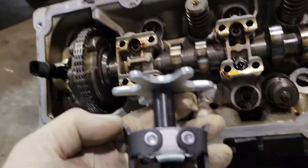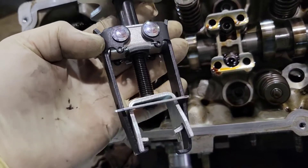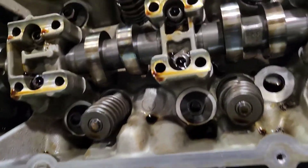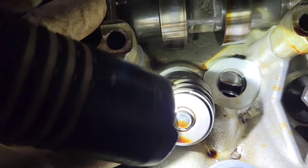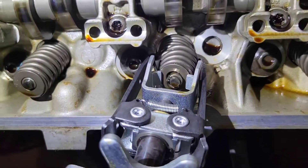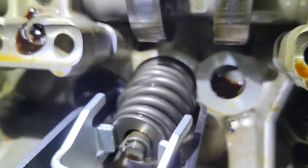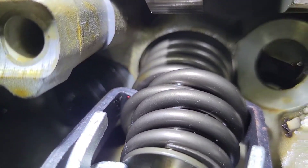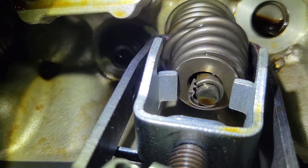There are a lot of different ways to do it. This valve spring compressor is what Ford recommends per the service information. We need to depress the hat to get the keepers out. Doing this with a broken valve spring is a little tricky because the spring doesn't have the space between coils to get the depressor in. You have to get the two arms into the spring, then put the top on the hat and screw it down until those keepers are exposed.